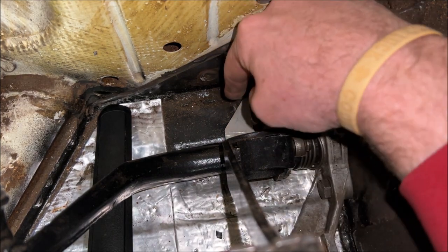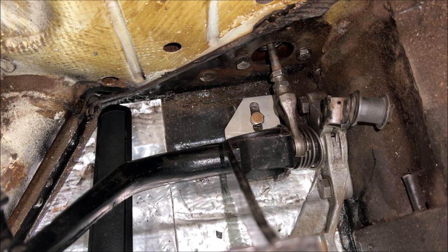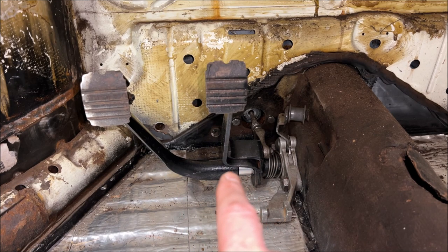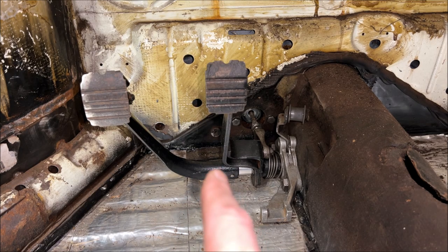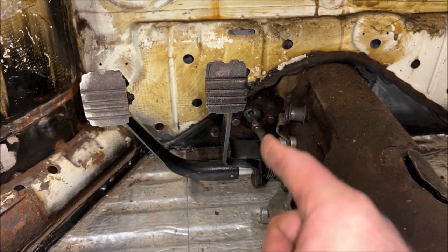Do you see that bolt? Mine may look different than yours because I have the big boy pedal extender to move the pedals further apart. But even the factory one will slide a little bit. You always want to adjust your pedals to where they should be. But if you loosen that up to make an adjustment, watch that your clutch pedal doesn't fall forward — because your clutch cable is going to come off, then you'll have to pull the assembly out. If you have moved the pedal assembly and moved that brake stop slide, recheck your adjustment. It is very, very important.